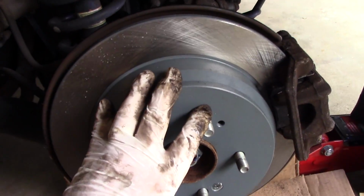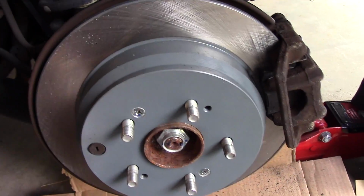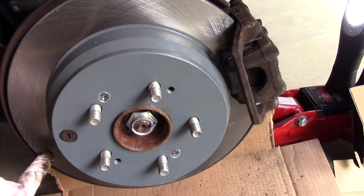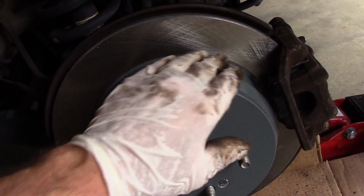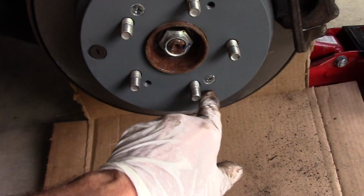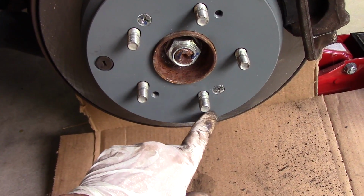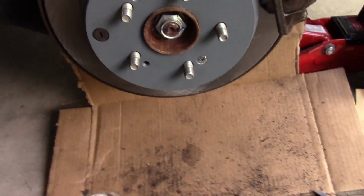Okay, we put our rotor on. We cleaned off everything on here. That was actually, this is just paper towel lint here. We cleaned off this rotor here to get all of that grease off of it during the shipping. We cleaned the outside, the inside, and where the parking brake goes. We put our 2 screws back in to hold the rotor to the vehicle. We put our little plug back in here. But before that, we made sure that the parking brake shoes were adjusted first. And you remember how to do that with the little screwdriver.